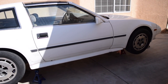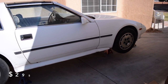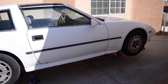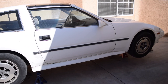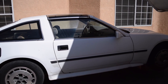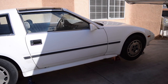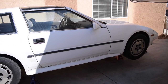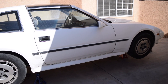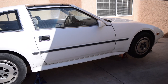I'll show you in a little bit and I'll put a link in the description for it. It's actually reasonably priced — I think it was around $350 — and it actually holds over 400 foot-pounds of torque and over 400 horsepower. Although horsepower isn't usually what you measure clutches in, it does list it for some reason. It is a lot cheaper than a South Bend clutch, which is a very respectable clutch, but they usually go for around $500 plus for that power range. It is still a sprung street clutch so it shouldn't be too rough on us.